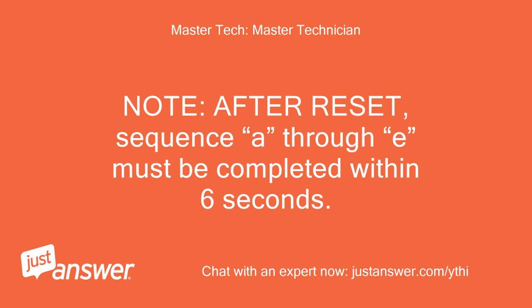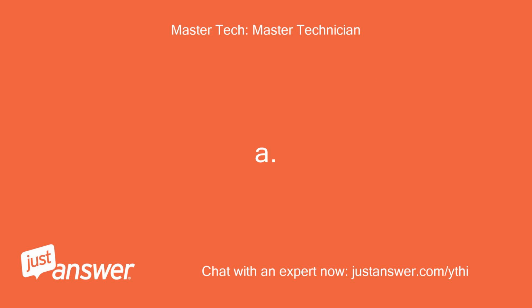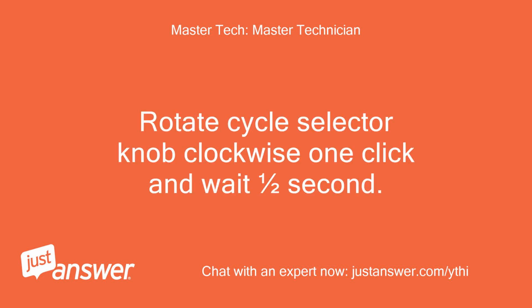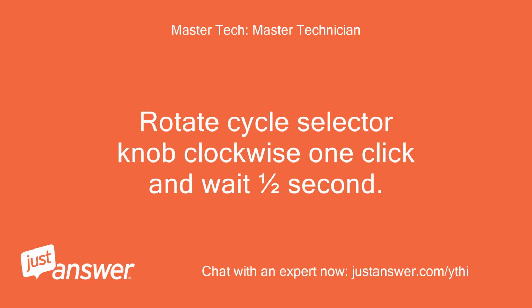Note: after reset, sequence A through E must be completed within 6 seconds. Reset: rotate cycle selector knob counterclockwise 1 or more clicks to clear sequence. A. Rotate cycle selector knob clockwise 1 click and wait half a second. B. Rotate cycle selector knob clockwise 1 click and wait half a second.